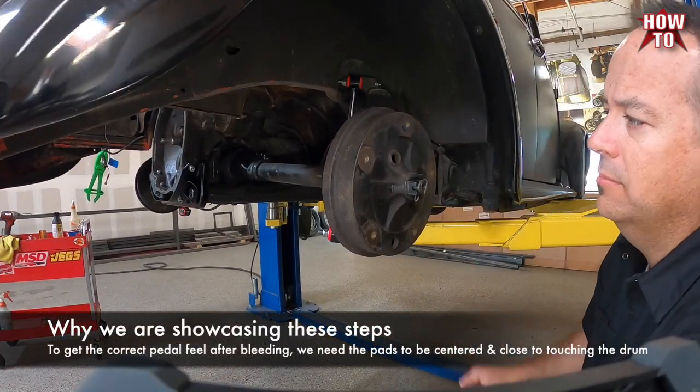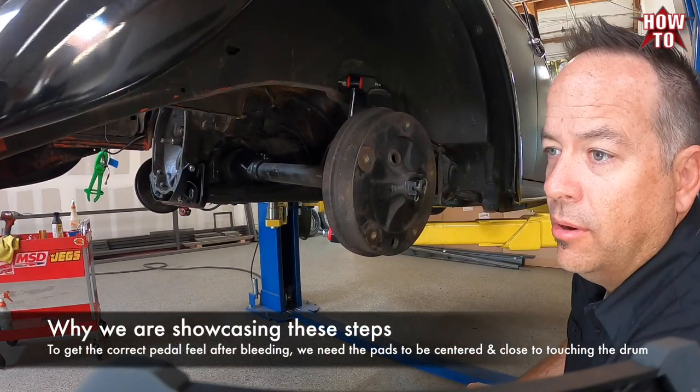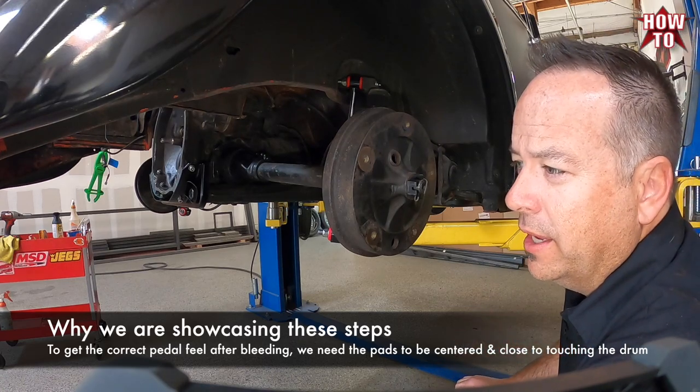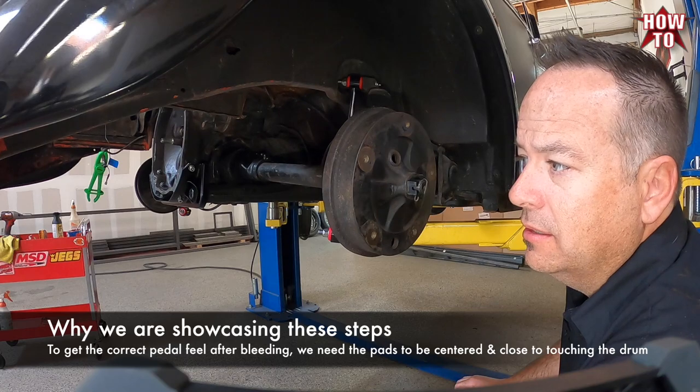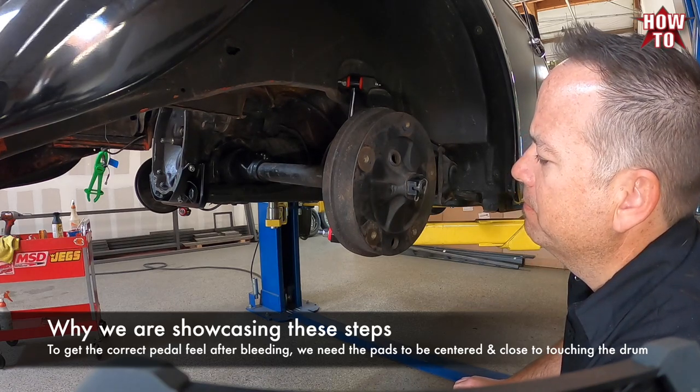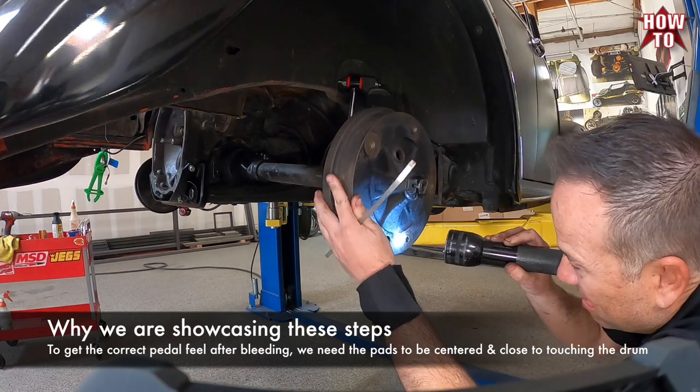The drums just were able to pull right off, which they weren't adjusted properly. So we're gonna adjust them properly now. We can't do it perfect right now because we need the pressure to do that. And so when we do that, we will fine tune this.